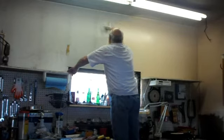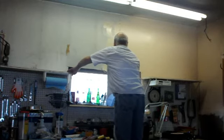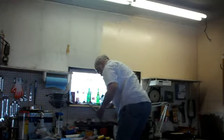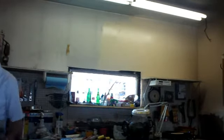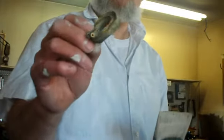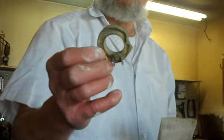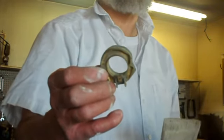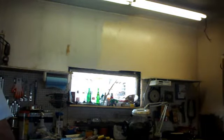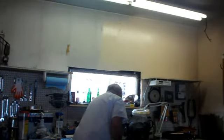Found these nails. That's where my clock goes. This is where my collapsed — what do you call it? Float. Yeah, carburetor float. I have a collapsed carburetor float that came out of one of my Tecumseh motors that I worked on this past winter. I had never seen one before. This came out of the carburetor on my lawn mower. That thing was collapsed right down. The reason the guy sold it to me was he couldn't figure out why it kept flooding over — gas just ran through it. He had no idea, so I got it for a cheap price. New float, runs great. So that hangs up on the wall just because I never saw that before.